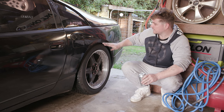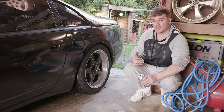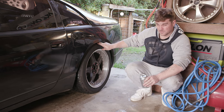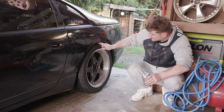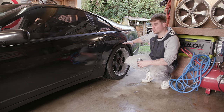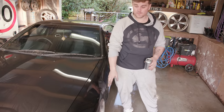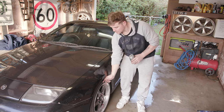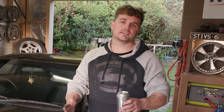We've just turned the car around and already noticed the rear suspension has settled. It's a much nicer look - more even from front to rear. It's going to look even better when we get those bigger tyres on the front - really should make the car sit near flat. As you can see there's a finger gap there, pretty tight. Overall I'm pretty happy with it. With the 275s in the back, all we really need to finish up this more flat look is the larger 245 tyres on the front, removing some of that negative camber to push the wheel out at the top. The suspension height is near perfect.